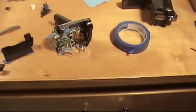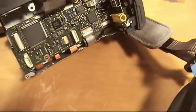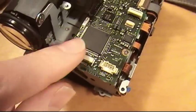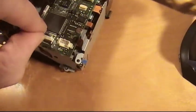Another thing: these ribbon cables — if you have ribbon cables, look very closely at how they come out. Make sure you don't force them out, because sometimes there's a little tab. You can see on that one there's a little lever that needs to go up and down. Make sure it's up when you put the ribbon in, then close it down. Because if you screw these ribbons up, you're done — you're not going to be fixing it unless you get a new circuit board, and you're better off just getting a new camera.